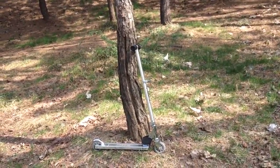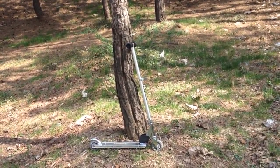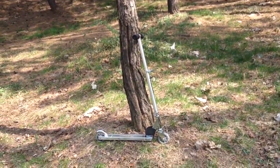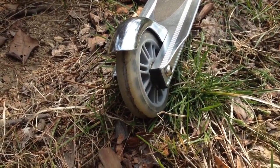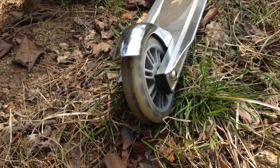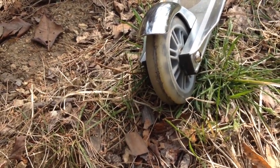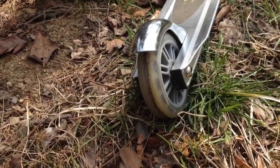Cons about this scooter are a couple of things. These are all from doing stunts — if you don't do any stunts these will not happen to you, unless you've got big hills which ruin your wheels. Going down big hills causes the brakes to heat up the wheels, and it peels off the rubber and ruins your wheels. If you haven't got any big hills this won't happen to you.